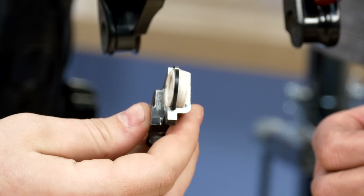This is a mineral-based system, so we're going to use mineral fluid. Reach in with a cotton swab and scrub all the way around — 360 degrees, looking all the way around the piston. You can kind of feel some dirt on there. Push this piston back a little to relieve the pressure up above. One piston's clean. Hold that side in and bring the other one out carefully and slowly. Fresh fluid — clean the bottom, top, and sides, 360 degrees of cleaning. Push it back into the body.